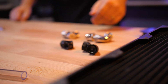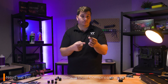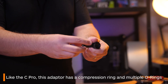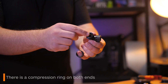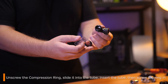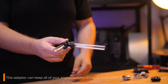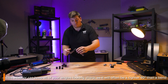The first of the angled fittings I'll show you today is this dual compression 90 degree fitting. If you prefer straight lines or if you want to avoid doing a complete 90 degree bend with tubing, these can quite easily bail you out. Like the C-Pro fitting, this one also has a compression ring on the outside to help create a tight seal, along with three included o-rings. The way it works is there's a compression ring on the outside of each end — unscrew the compression ring, slide it onto your tubing, push your tube into the socket and then thread the compression ring over the top. Depending on the look you're going for, these can keep all of your angles looking sharp as it'll often be a tighter angle than your freehand 90 degree bends.